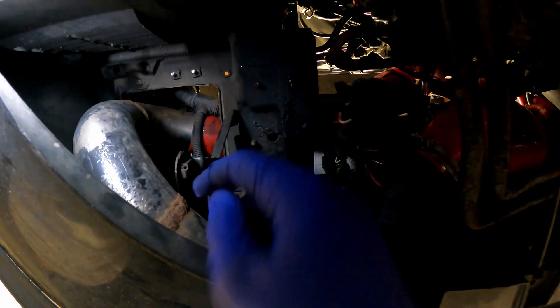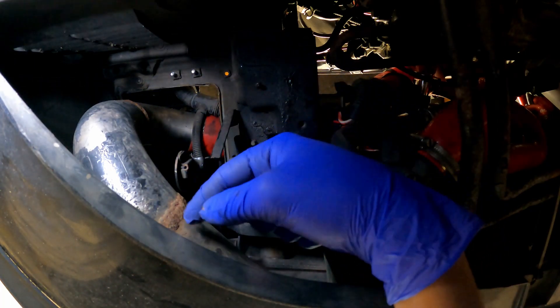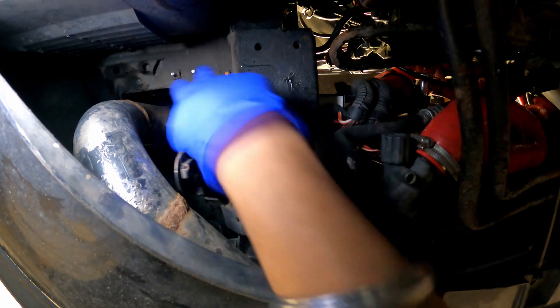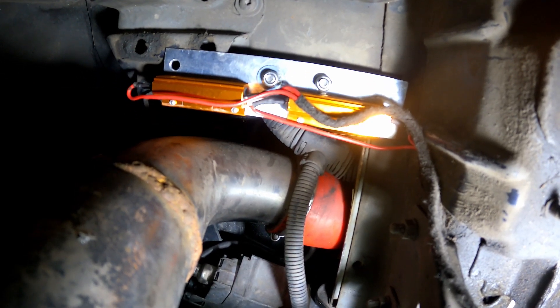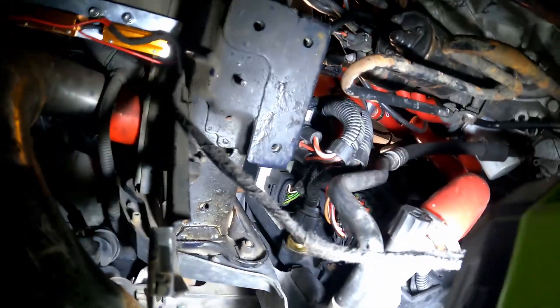This is underneath the chassis leg, and this is the turbo pipe I was talking about - a hard metal pipe I made two years ago. Do you see those two bolt studs I've drilled through from the top? My resistors are going to plate up to that and bolt on. That's the plate mounted up - it's literally just got two bolts on those studs put in from the top with two nuts on the end, and that's job done. The wires trail down and I'm going to connect them into the radiator fan switch right there.